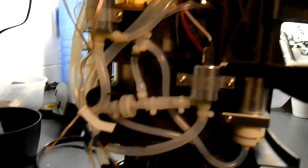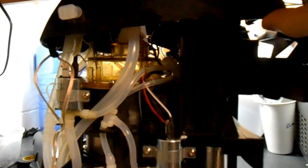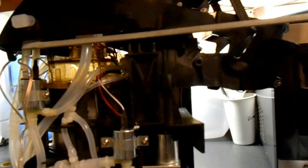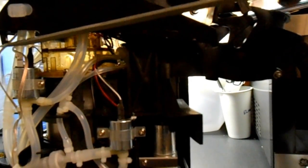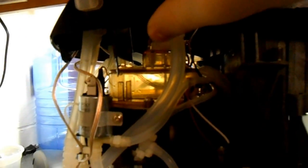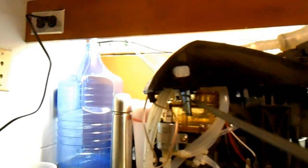And how I did this was, first off, I went over here and pried this up as high as I could, and then took a screwdriver, came in the side, and pushed this snap right here until this whole entire side popped off. And that's pretty much the easiest one. It only gets worse from here. Next, you're going to want to pull up this side as much as you can, and then you're going to just take a screwdriver and go through this gap right here.